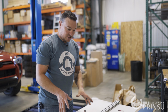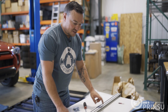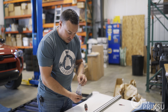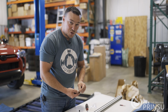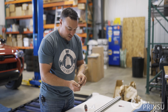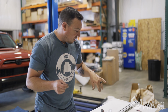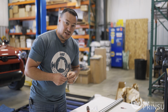Okay, moving on, now we're gonna talk about assembling the wind deflector. So we have the silver crossbar that's indicated to go with the wind deflector, and we have our bag of hardware that contains the hardware for this. Inside this bag will be some Phillips head screws. You can go ahead and get those prepped by installing the washer on them and some Loctite. And then these T-nuts, we can insert those into the crossbar. Make sure you put the threaded side facing up. Once you get all these slid in, then you can get your noise reducing trim applied and start getting this bolted together.